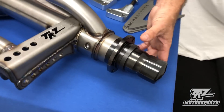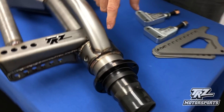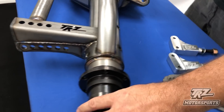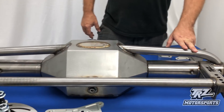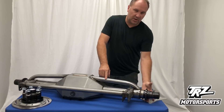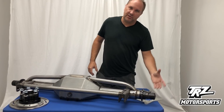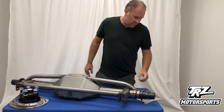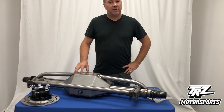This is a Strange floater, with a big spindle that sits inside the housing about 10 inches. The benefit is we can do these nice plug welds here to strengthen it up. The axles — Strange is going to be shipping them direct to the customer — these are going to be some 40-spline 300M axles. Should you break an axle, everything stays internal because the hub stays bolted on. You don't have to worry about the wheel doing anything dangerous. If you've ever seen a car break an axle, the wheel starts twisting around — hopefully it doesn't come off, but it's not a good situation. That's the benefit of the floater, and kind of why it's mandated at higher speeds.